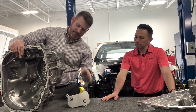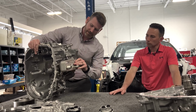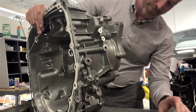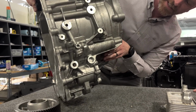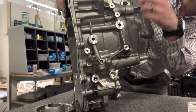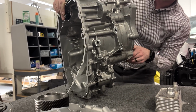No, I would agree. This is essentially the front of the EDM, if this is the front of the vehicle, and it mounts here. And again, it's kind of to my point with respect to maybe a manifold assembly down in the future. You can see all the multi-axis machine operations and different cooling paths, because the oil pump sits here and essentially is pulling in from the bottom of the case and then driving everything up through this side of the housing, and then again the gearbox bulkhead itself.